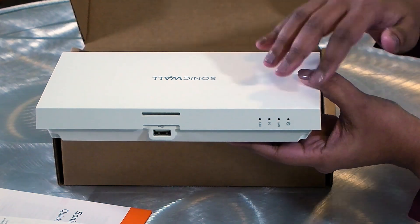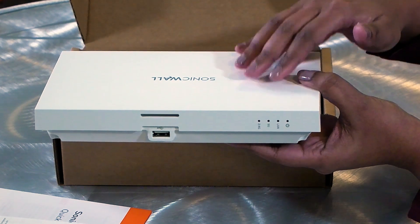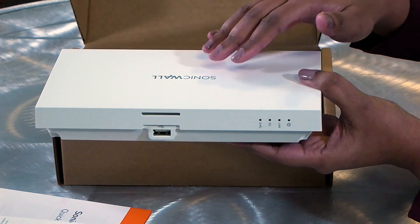The LED light patterns signify different scenarios. Generally, if the LEDs don't light up, it means the device is not operational. Solid green indicates that the radio is on, while blinking green indicates there's active traffic. These LEDs are dimmable, which makes them extremely useful for discrete deployments — for instance, in hospitals and hotel rooms where blinking lights can be annoying.